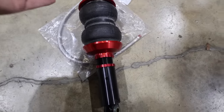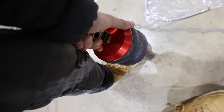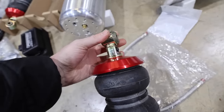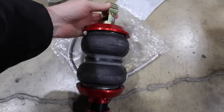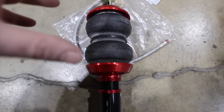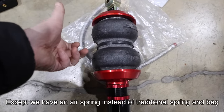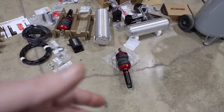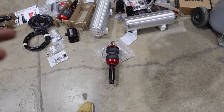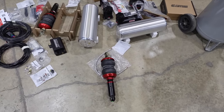This is the builder series — the compact bellow style we're running in the front. In the back this car uses a dual shock setup, so we've got the sleeve style. It's a shock with an air spring inside — I can compress it with my hand and it slowly rebounds. You've got stiffness settings right there. It's exactly how Lamborghini does it from an engineering standpoint, but we have a lot more throw in our air spring. That's going to allow us to lower the ride height super low and then go super high — so I can finally get this car in my driveway.